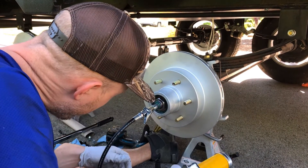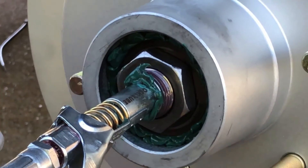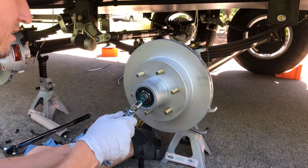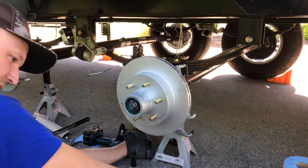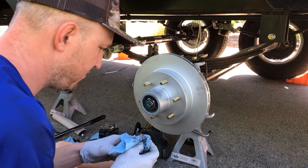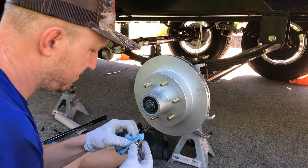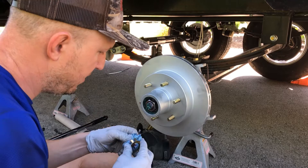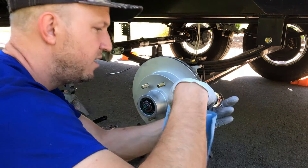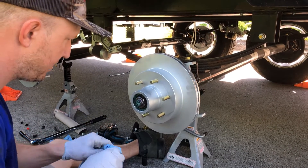Check that you don't feel any free play and that you've got smooth rotation. That's generally what you want. Do a final extra fill to make sure it's packed all the way around — you can see the grease coming all the way around. Give it a little rotation to make sure it's packing all sides evenly. That is a packed system. I'm also not going to get into the debate about what type of grease to use — there are a million opinions. I chose a heavier duty version; red and tacky is also fine.